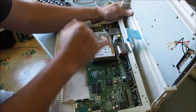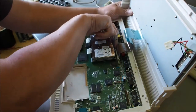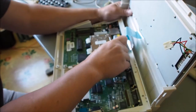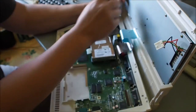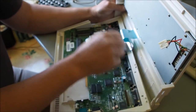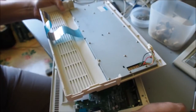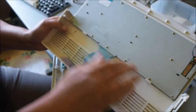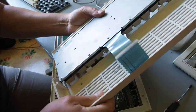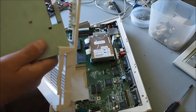You'll notice down in here there's a little white keyboard connector. The best way to get that up is to get your finger into it and pull - get your fingernail under it, or even just a screwdriver if you can't get in there. Pull the cable out, then release these two lugs here and the keyboard will just pop out, being careful of this cable that comes through the hole.